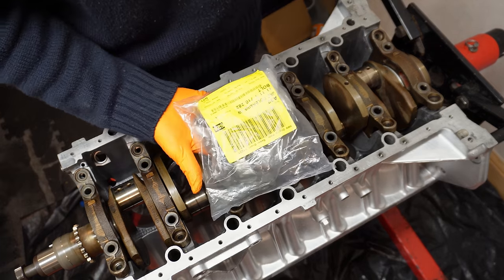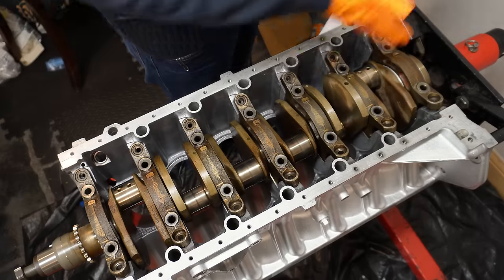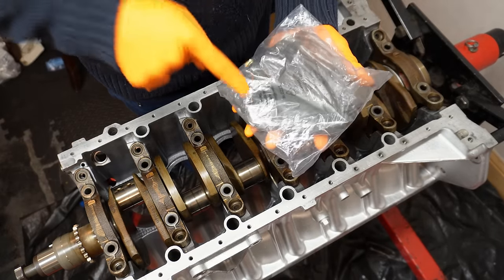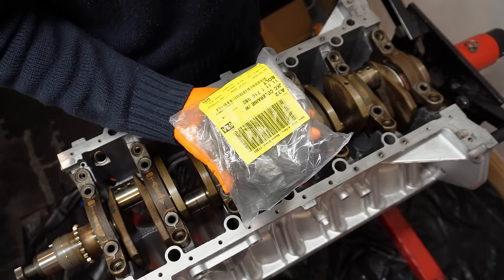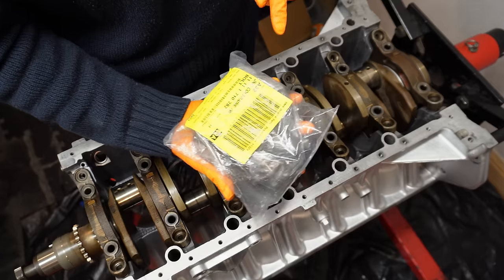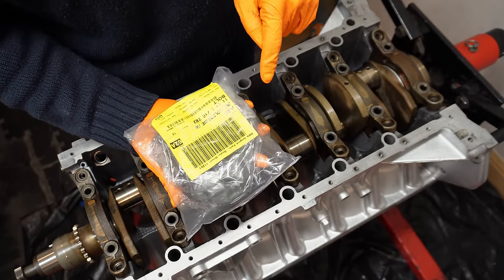Yeah, so let's talk bolts for a second. I do have a brand new set of bolts here from BMW. We've got all 14 of them. They are 17mm Torx single-use stretch bolts. And we will not be using them at this stage because these are €150, so they're €10 a bolt. Again, no aftermarket options, so you have to go with the BMW ones.